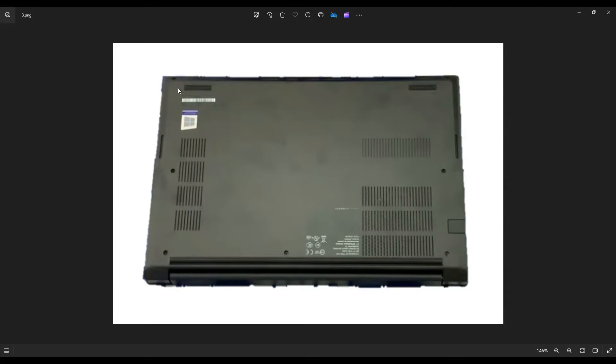There are three screws on this side, three on the other side, one here in the middle, and there's either one or two on top depending on what model you have. Then you're going to use a small plastic pry tool, maybe like a guitar pick, and go across the seam all the way around the computer and slowly, carefully pry apart the bottom case from the palm rest.